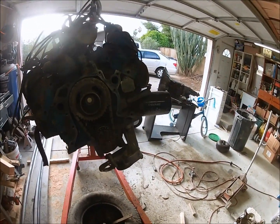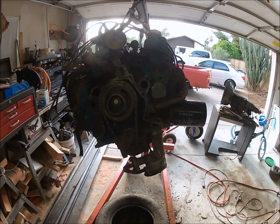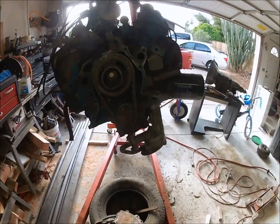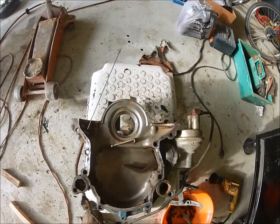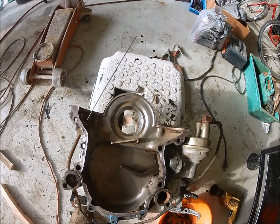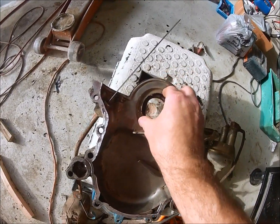This is a 1970s early 70s Ford 302 V8 out of a Mustang — at least that's what the numbers say. Here I'm replacing the front main seal. I have already removed it. To do this you have to take off the timing cover; it's aluminum. It's a front main seal and it goes on the inside.